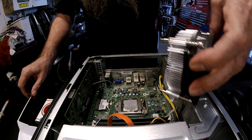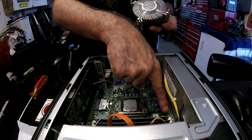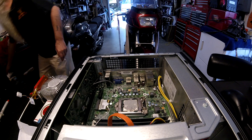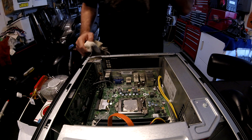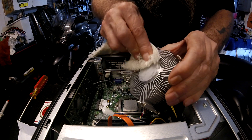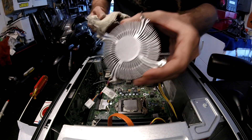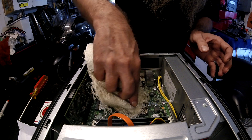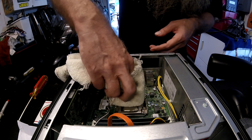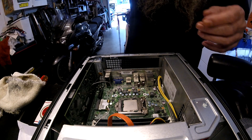That's off. Now I'm going to disconnect the fan — it's just on a little speed plug, it's right down there. I'll show it again when I put it back on. I'm going to clean the heat sink compound off the bottom of the fan — that's clean enough. I'm also going to clean the heat sink compound off the old CPU so it's nice and clean when I put it in the tray. If you don't have a tray, stick it in something static-free — a paper envelope, or a static bag if you've got one.